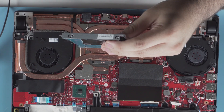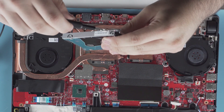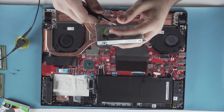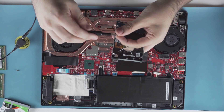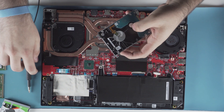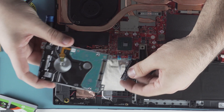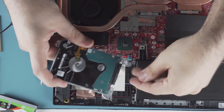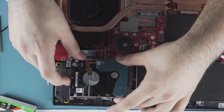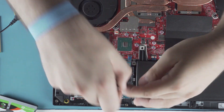Easy enough — remove the four screws on the side and swap in the new drive using the same screws. Make sure the new drive is in the same orientation as before. When you put it back, connect your SATA data and power — it's already routed to the board, so no need to worry about that. Line the drive back up; there are little knobs to help keep it in place, and then just tap back in the four screws you took out earlier.